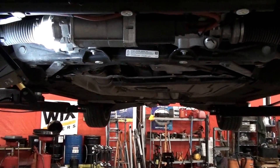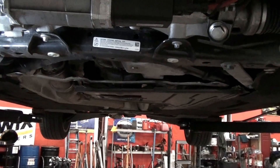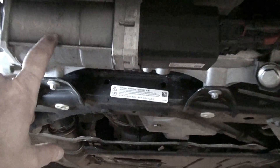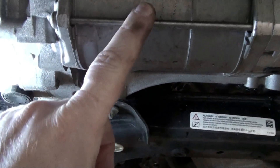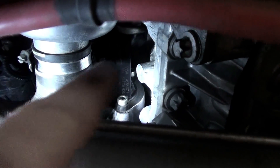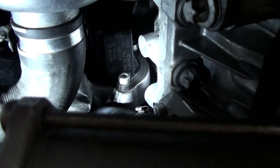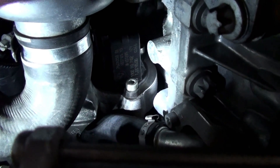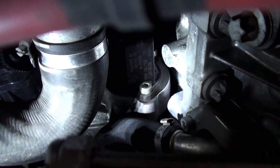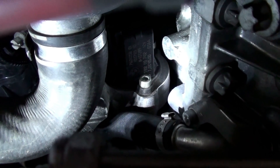Forgive the background noise — this is a working garage. After pulling the belly pan off, there's an additional plastic shield with three bolts across the front. Pull those off and the shield will slide off. You're now looking at your steering rack. Moving up, you can see this pipe here, and right there you can see the bolt — that's the bottom bolt of the three bolts on your diverter valve. You're going to have to get in there and reach all three of those to pull it out. I'll pull those three bolts and show you what's next.